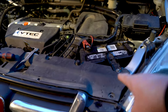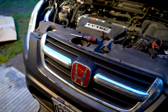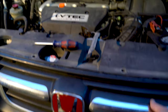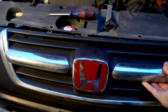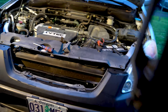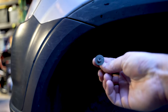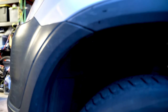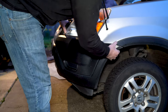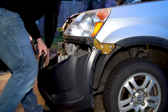To install these, the first thing you're going to want to do is take off the top plastic cowling, then take all the clips off the bottom of the grill, and once you have all those off you'll be able to just pull the grill off — just give it a little yank. Then there are some clips down here on the fender wells and a couple of Phillips screws; you can also use an 8-millimeter socket. There are just two, one on each side.